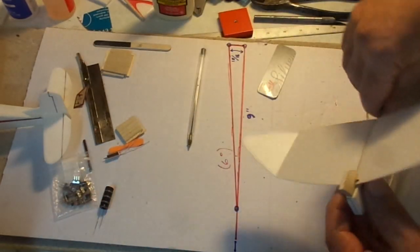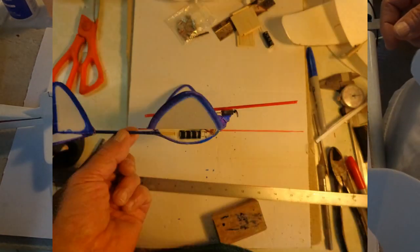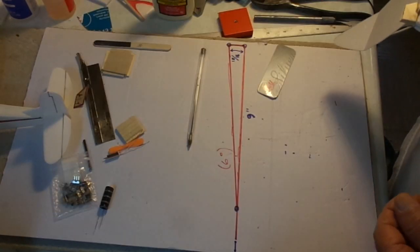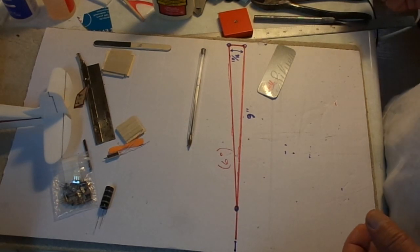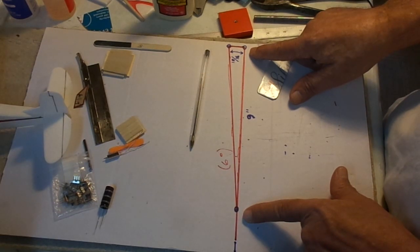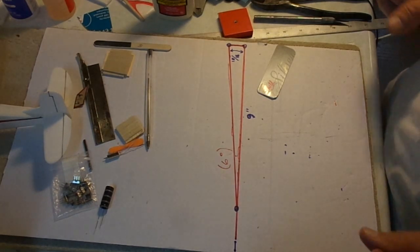it turns out that the amount of up thrust that we need, and let's put up a photo right here to show you a little clearer, is 6 degrees of up thrust in this design. Probably the easiest way to eyeball that without any measuring instruments is to draw a little diagram that we can use as a reference, and we're going to eyeball that thrust adjustment in there. I think it's probably as accurate as any way to do it, just by eyeball.